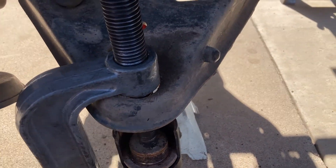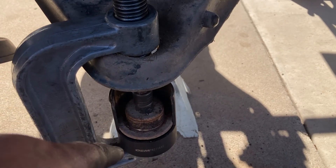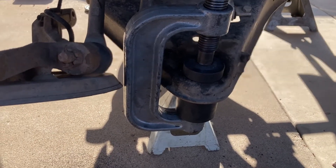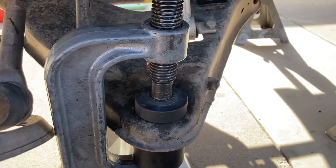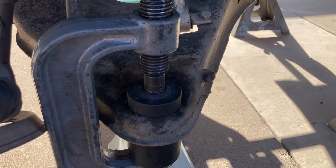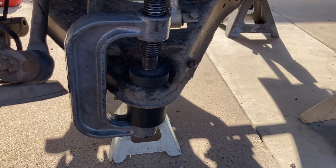Now what we're going to do is take this apart, clean this surface — I have a brass brush and some brake clean. I'll show you what it looks like when you go to install it. We're ready to press in the new ball joint — it is in here. The threaded part is sticking through here and then this cap — you just tighten it till you can't really tighten it anymore. When I did the other side, I took it off a couple of times because I thought I was done but there was still more to be tightened down.